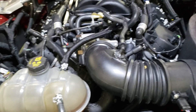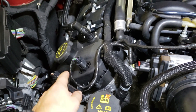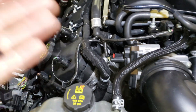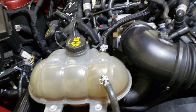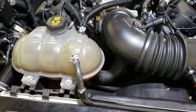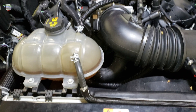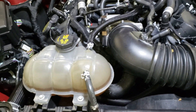If you feel like you might have multiple plug failures, replacing the full harness is worth the peace of mind. One easy way to check if this is your culprit: start the car and jiggle the connectors around. If messing with them causes the car to go from running fine to a rough idle and back — shorting in and out — that's a clear sign. A more thorough method is a continuity and resistance test, which is covered in the engine manual. If you're getting this problem, please look at the wiring — it's very likely your culprit.